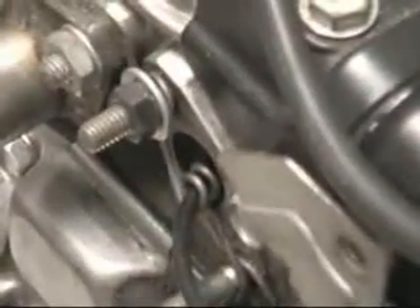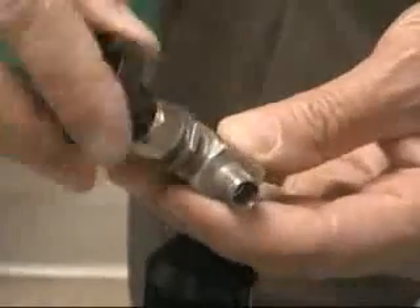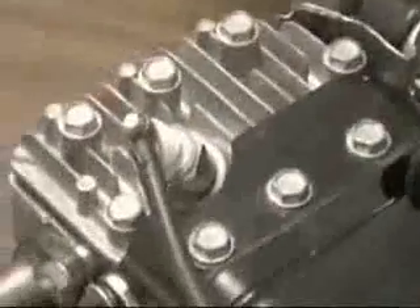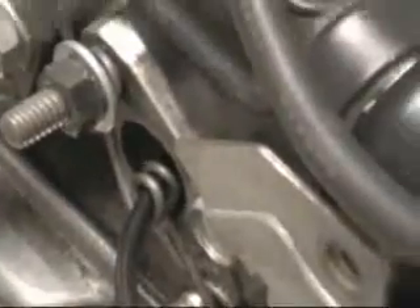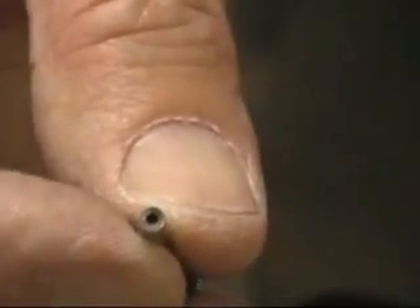We're doing the engine power control with a metering valve, which is a needle-type valve common to the instrumentation industry, where it would be used for controlling the flow of nitrogen, oxygen, or hydrogen in a lab. It's sized for delivery on an eighth-inch tube; we then cut it down to an even smaller diameter at the point of injecting — about a sixteenth of an inch — as an example of the orifice size used for delivering hydrogen at the intake port on a very inexpensive conversion.